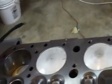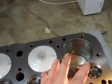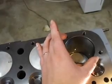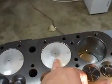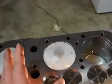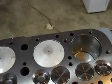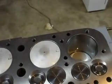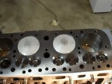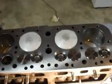And he was talking to another guy that just did a Ford 9N, and he warned him, there is a clearance for how big that can get. He says you want to go to the high side because these newer pistons will actually swell when they get hot, and the tractor will run fine, it will run great, but when you shut it off and maybe you go in for a drink of water or something, you come back out and the starter won't even turn the engine over because it just got too tight. It swelled up and it swelled shut. If you let the engine cool completely, it would fire right back up again.